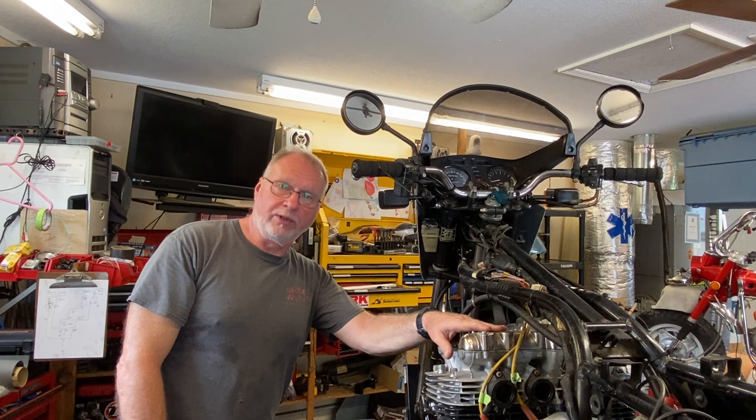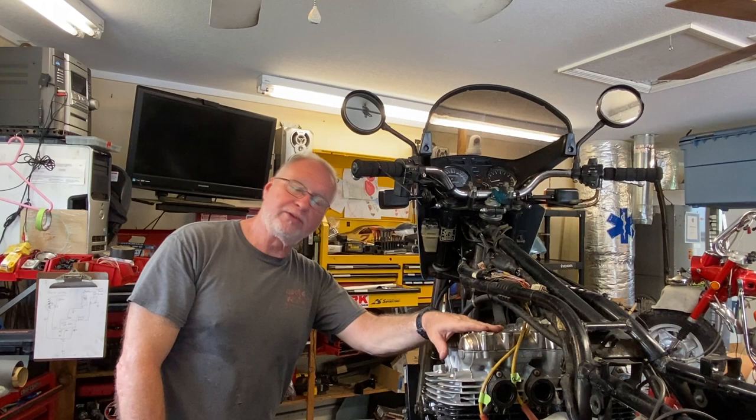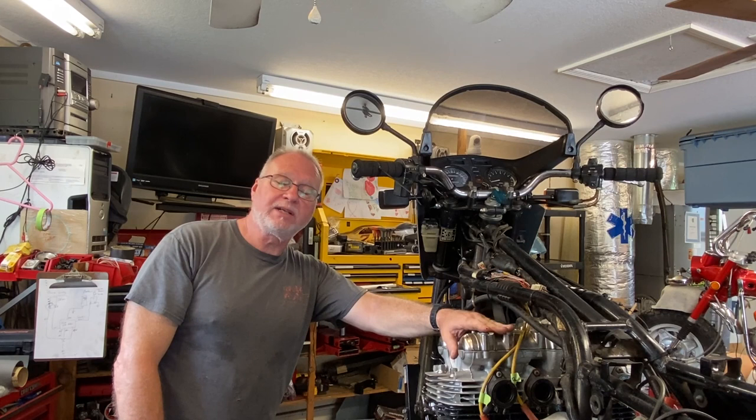So if we have a leak down showing a bypass of an unacceptable amount into the cylinder block past the rings, there's your oil consumption problem. If we don't, then it might be in the valves. And then we can certainly have an oil consumption problem based upon some damage or wear to the valve stem seals. So stay tuned to the next video. This one's already, as I said, long enough. We'll get to that here real soon.